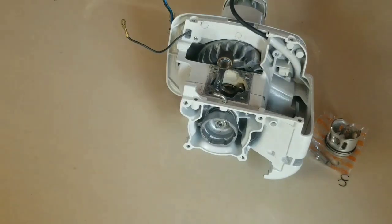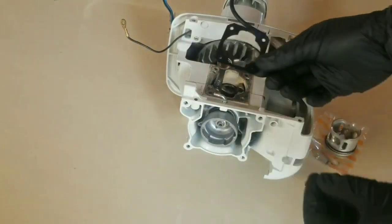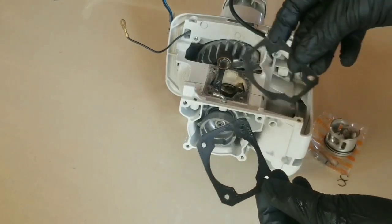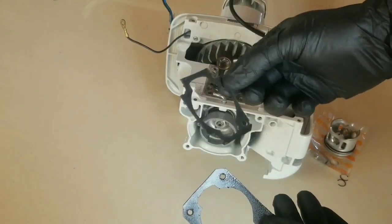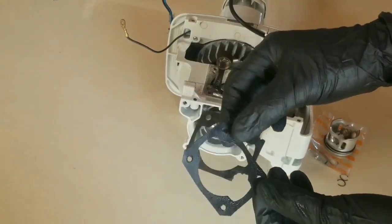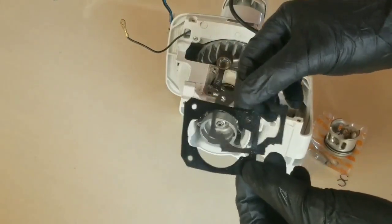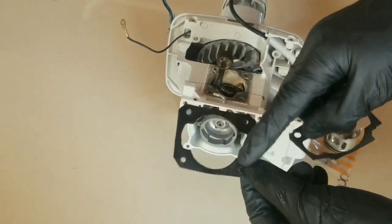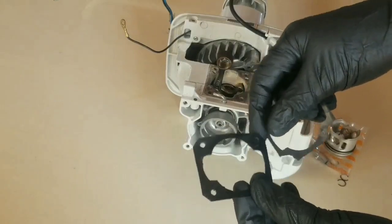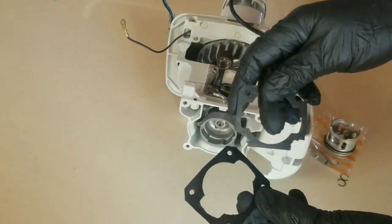Also, as a part of the assembly, is the gasket for seating the cylinder head on top of the framework for the STIHL machine. Now you have the factory STIHL gasket. In the event you cannot get this gasket, you might have to make one like we did here. Most of the time it's going to be paper, so you want to spray paint it, making it oil proof and oil resistant, so the oil will not leak or sweat from the gasket joint.